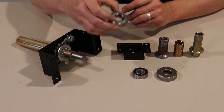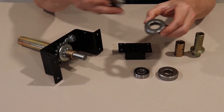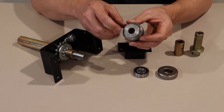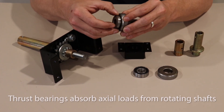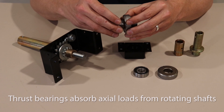The orientation of this thrust bearing is important as there is an open face and a closed face. Here we have the thrust nut. The proper orientation is like this — the base of the thrust nut sits against the open face of the bearing. If it's installed backwards, the pop-up will be extremely difficult to crank as you're feeling the entire weight of the roof and lift system resistance.